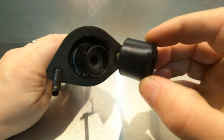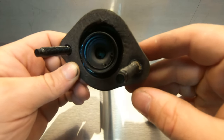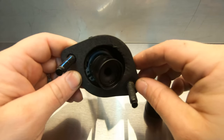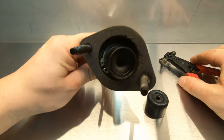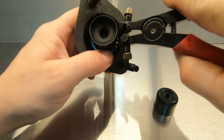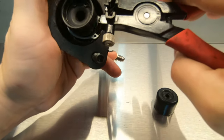You come around to the back — there's a little cap. I pulled the cap off. And then deep down inside, both my stock one and this one, the snap ring was buried over here on the deep end and I couldn't get my snap ring pliers in there. So I had to take two small flat heads and kind of screw with it and get it rotated around. But once you get it spun around, you can take your snap ring pliers and get that snap ring. I do not have the best snap ring pliers — mine actually kind of sucked. But so if I can do it, you can do it. You wrestle the snap ring off of here.